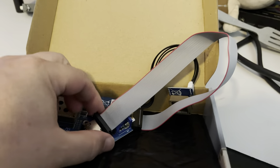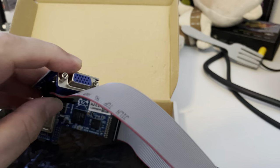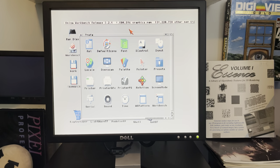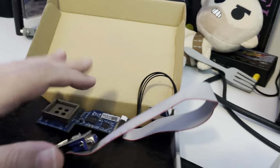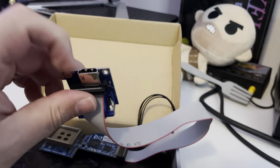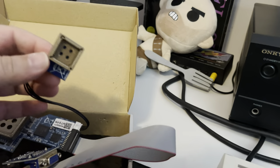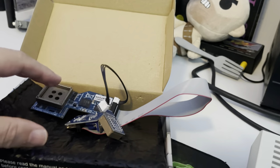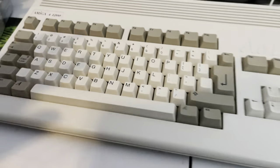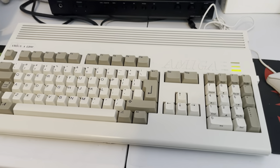This little guy, much like the Scan Plus, jumps onto your chip and then you get the option of HDMI out or VGA out. I'm going to be using VGA because I like the classic look of the 4x3 17-inch VGA look, and this will give me a nice clean signal. Using the software that comes with this you can actually get audio out of the HDMI as well. They give you this other little vampire-like suction cup chip that goes on to the other chip on the board so you can control this in Workbench and use the keyboard to make adjustments to the settings.